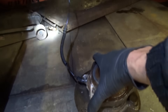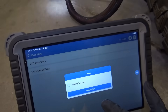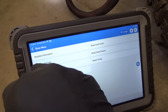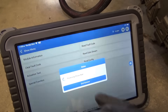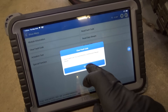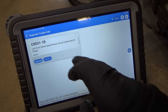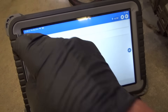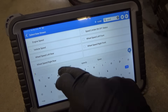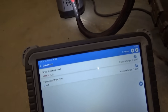Good thing we have this old hub and sensor assembly. That's plugged in — let's read the fault code. It still says active, so let's try to clear it out. DTC is still present. Read fault code — still the same code. Let's go back to data and look at the speed — left front, right front — still showing the same.